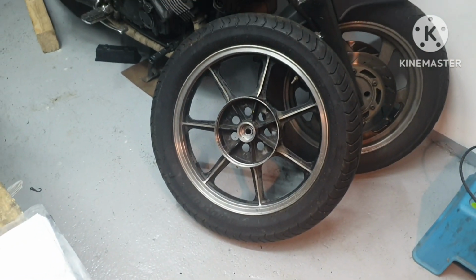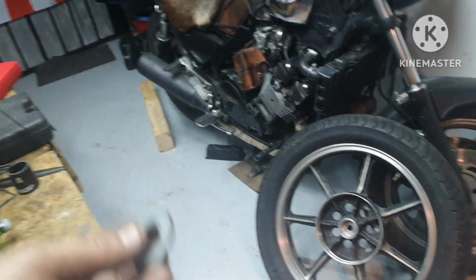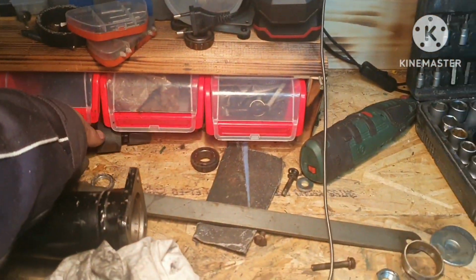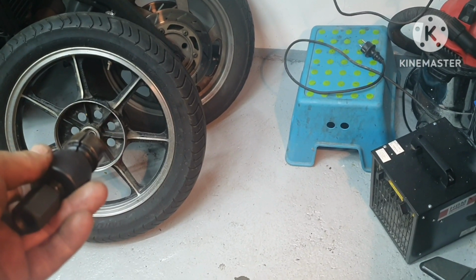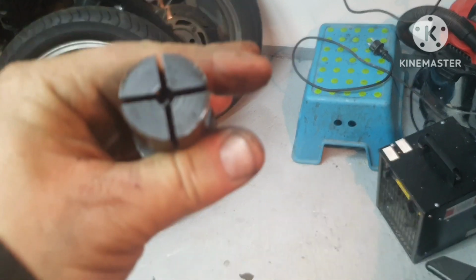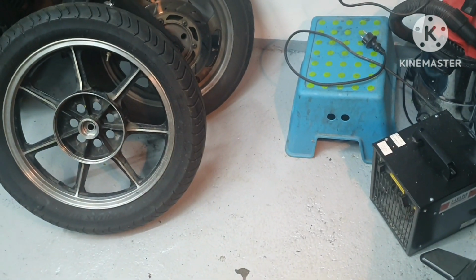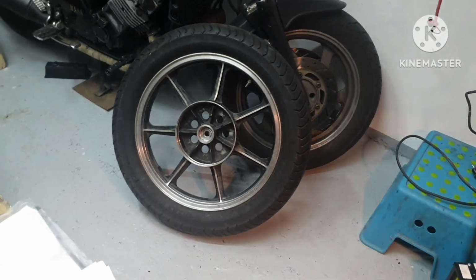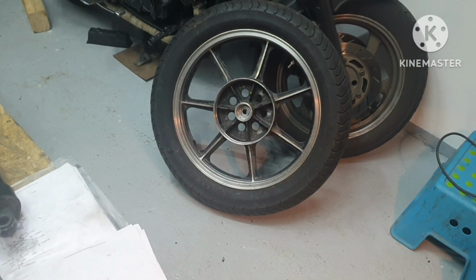As for the bearings, I had trouble because I cannot use that bat, you know, that tool that I got, but I used the extension of that tool. So I just put it there, not this one, this one is bigger, but the same one, put it there. And then from the other side, put the steel rod and hit it here. And that way, I almost immediately pulled off one bearing, and then of course the other one was easy.